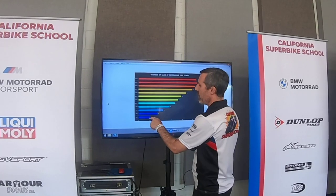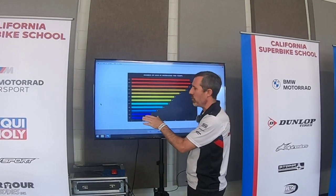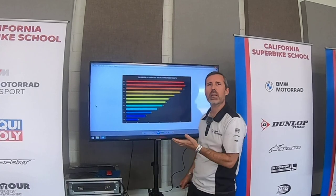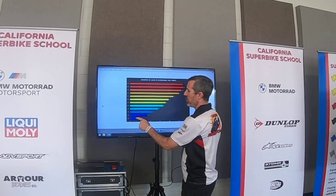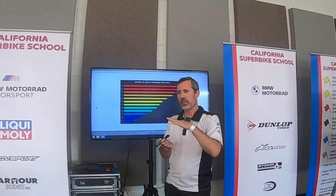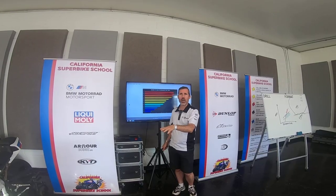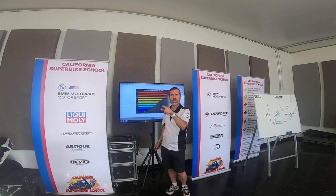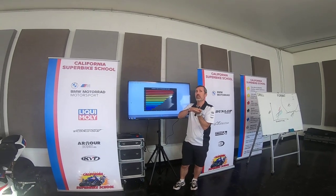The tires are not immediately going to go from 32 to 50 degrees, but as you roll through the corners, the carcass is going to flex. When a tire is touching the ground, it's slightly flat where it meets the road — it's not always perfectly round — and it's that little area where it's buckling that we get flexing, and flexing is actually where we get the heat. If you imagine a metal spoon and wanted to heat it up: rubbing it on your jeans would eventually get it hot, but bending it would get it hot really fast. That's the same principle for warming up a tire.